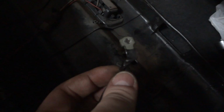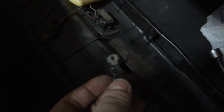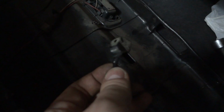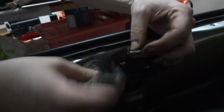What I recommend is that you clean everything up and then maybe remake the insulation on the surrounding area. Just this tip should be clean and into contact with the metal. You should perhaps place a bit of tape on this side to improve the insulation on the surrounding area. See, I'm cleaning everything around the end of the wire so that the electrical tape will adhere correctly.